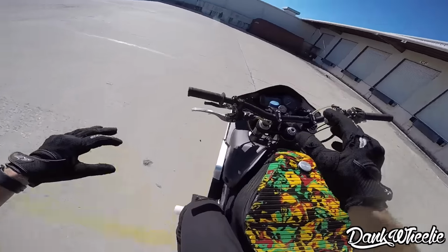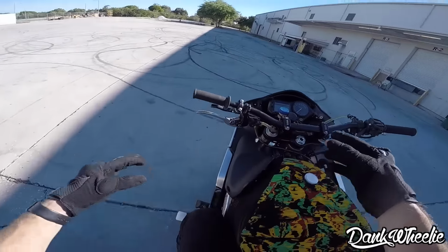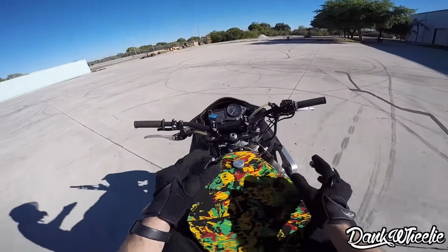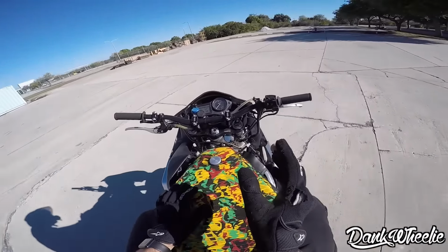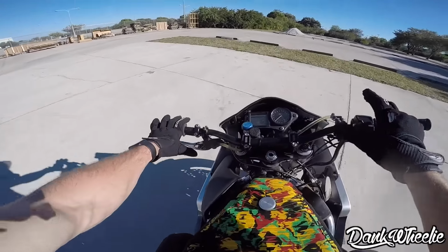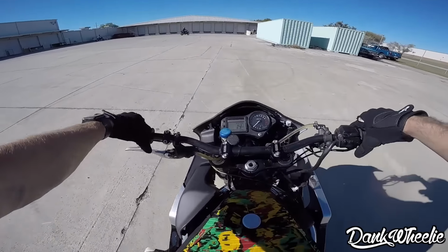With that being said, now that you have your idle nice and where you want it, think about this speed. If you're not using any throttle, is this too fast or too slow for a wheelie? Because this is the idle you're going to be at. If you're at the perfect balance point and not using any throttle, this is the speed your wheelies should be at.